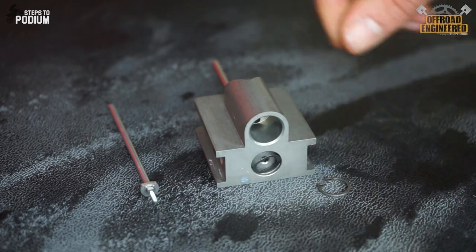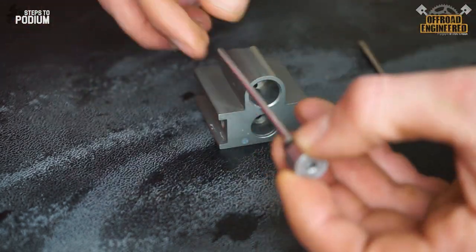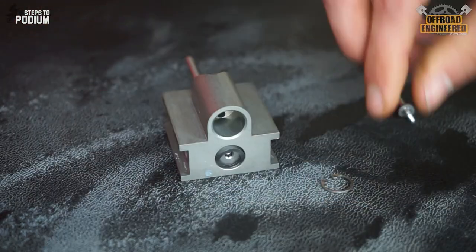If you want to change the mid to top end response of the engine, you have to open the carb's top cap and remove the slide to change the metering rod. But considering the clever adjustment system on the slide, you really don't have much to go wrong with when replacing the metering rod. The Smart Carb combines simplicity and innovation with significant improvement figures, making it the next-generation carburetor and perhaps even delaying the need for fuel injection. Only time will tell. I'll also be doing some performance and fuel mileage tests, so keep an eye on the next episodes. Hope you liked it — thank you for watching, and if you have any questions, leave them in the comments below.